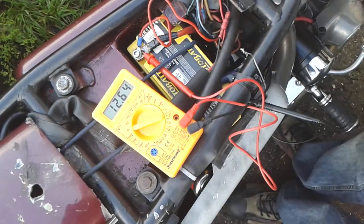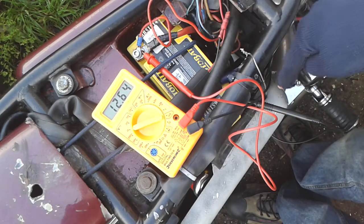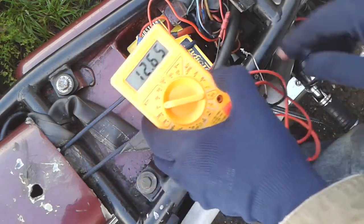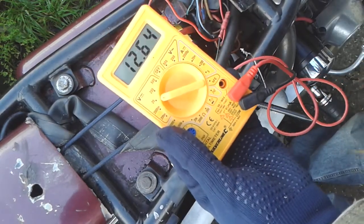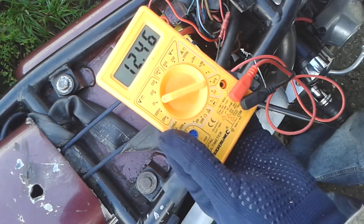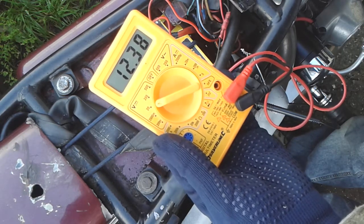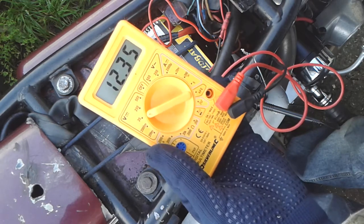Well, I lost my keys for a bit. I've got the terminals a bit tighter. Fingers crossed, we're going to try it again because those readings seem to be all over the place. 12.6 — that's lovely, that's exactly what you want for starting a Harley. Turn the ignition on. It's dropping, it's dropping, it's dropping. Should it be dropping like that? I'm pretty sure it should drop a little bit, but that's just stock exchange behaviour we're seeing at the moment.